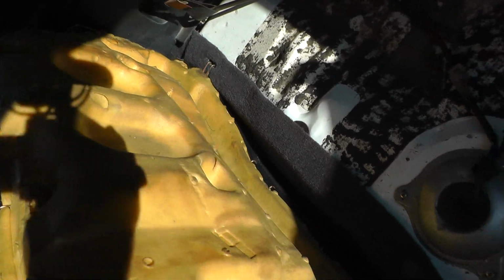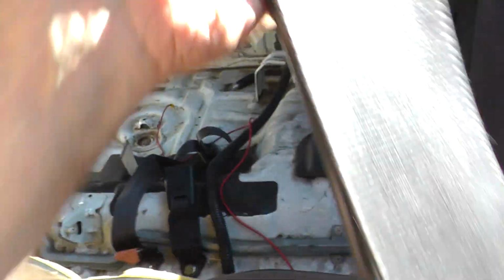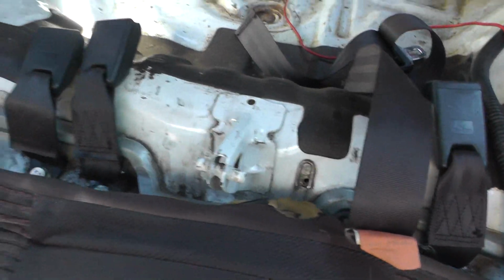Right, so just pop this seat down on these two little hook things, one there, one there, and then obviously place the seat belts out the way, and these hooks for the front seat belts, both sides obviously, this one, and then that can just go down on the 10mm. Don't forget you're going to need your seat belts like that.